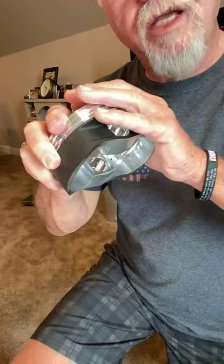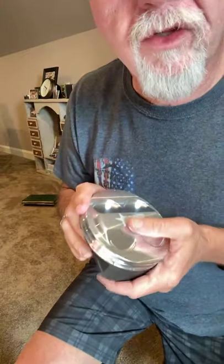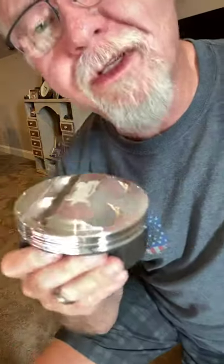That's just an idea. Then after the engine, the heads and the cylinders are cool to touch, crank it up and let it run for another 30 minutes. Then we let it cool to touch, then we crank it up and let it run for another 30 seconds. Not 30 minutes, sorry, y'all. I meant to say we let it run for 30 seconds.